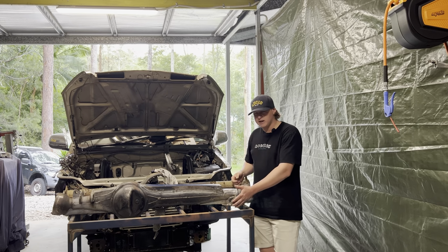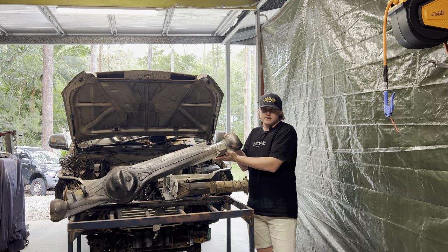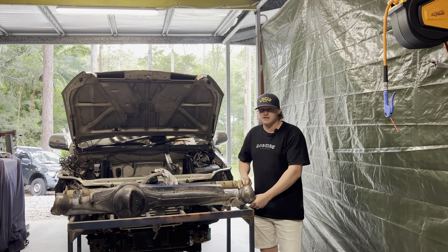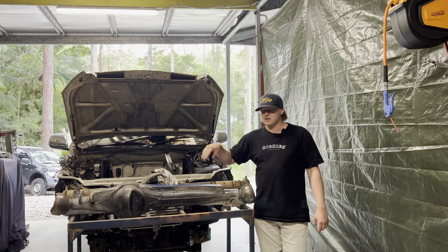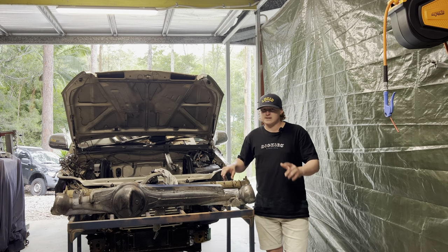I've done my panhard mount, all bracing underneath. You can see she's got the nice big fillets down underneath the knuckles, ties into the knuckle balls and down the length of the housing. Done my boxing on top, just to help give a bit of strength down the long side. And tied that into my radius arm mounts. So we'll cut to that now.